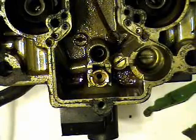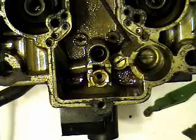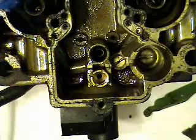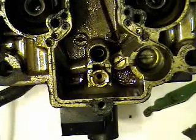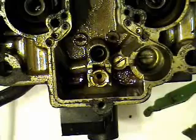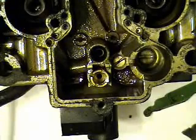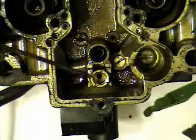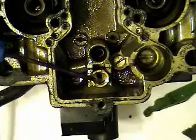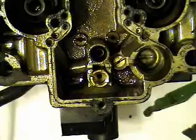You can see the passage the check ball runs right down to. There's actually one on this side too, right here — these holes right here will blow that check ball right out. We're going to go ahead and remove these. I just use a flat head screwdriver, and I use a big one for this one.